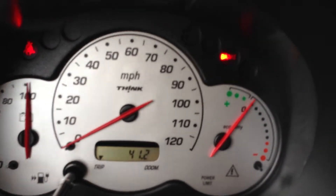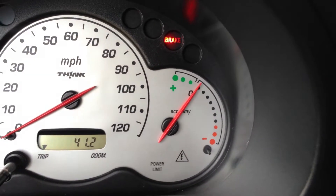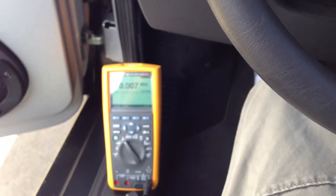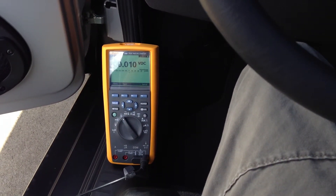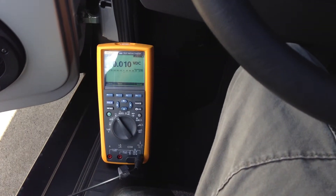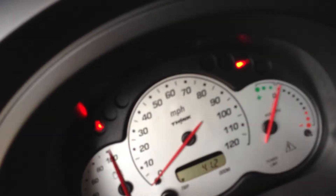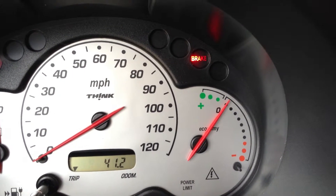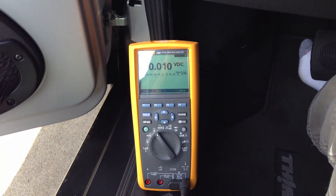Let me show you this a little bit closer — that's showing right at almost the one-dot mark. I wonder if it changes if I go to full fan speed. I'll go to number 4 fan speed. Now it looks like we are holding at around 10 amps, and the economy meter also seems to be at that first dot pretty consistently. We're at 10 to 11 amps — fan speed seems to be affecting it in some way.